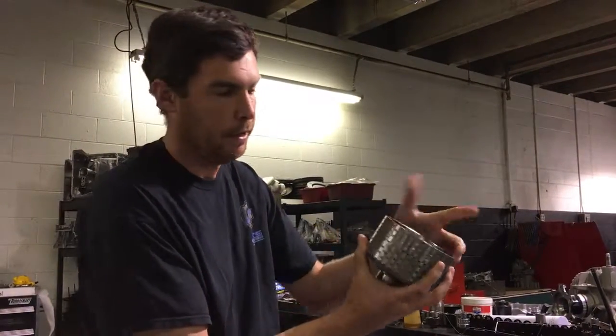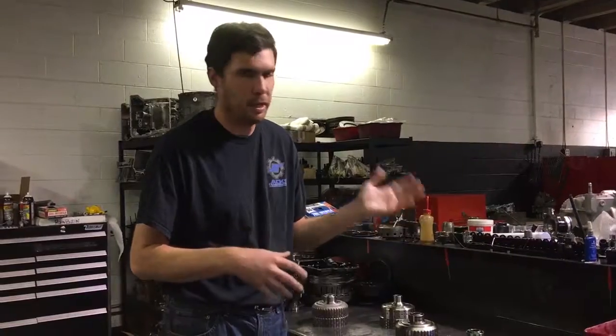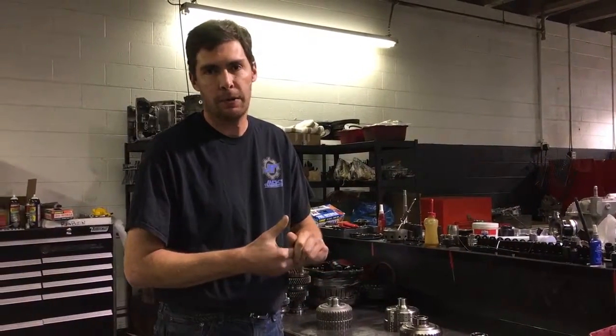It's just a much better fit. These units are a lot thicker and heavier than the old design, so it's less likely they're going to break, and they're engineered to be used from factory all the way up to a 20 plate clutch. We sell them for any clutch build across the board, and they're obviously a quality basket.